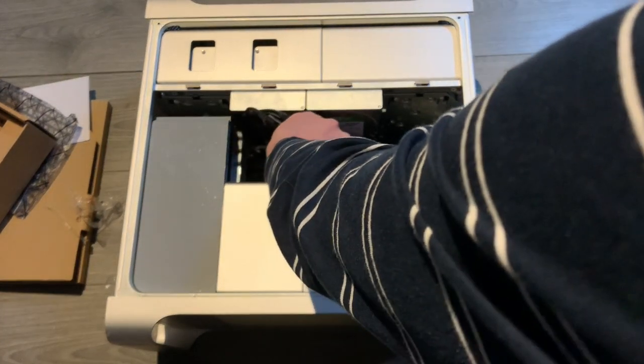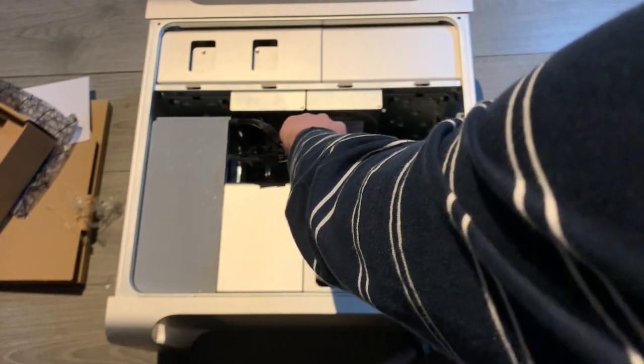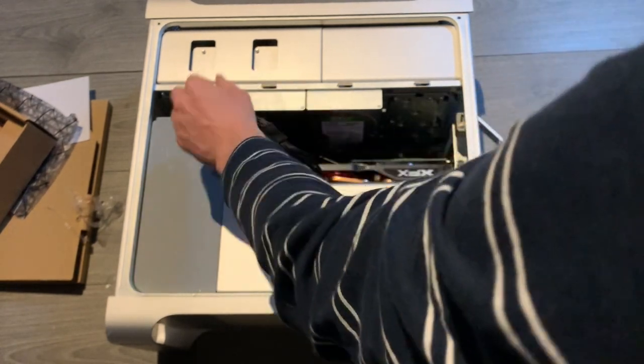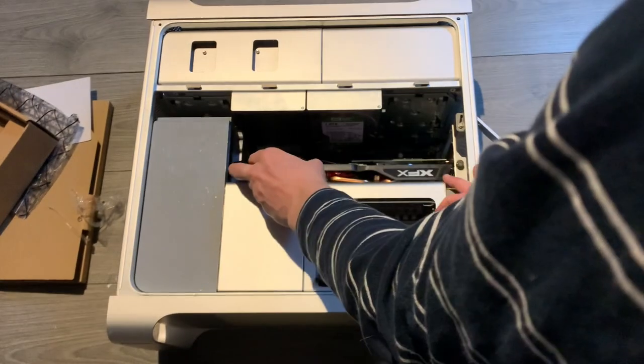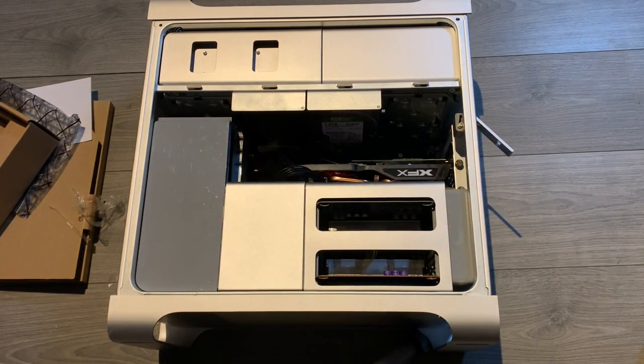Now, I've also read that most of these RX 570 and some RX 580 cards even will work fine sometimes on a single 6-pin, on the newer Mac Pro 4.1, for instance. But I don't want to leave it to chance to figure that one out. I prefer to do it somewhat properly, and this should be the route to take. It's not a particularly power-hungry card, the 570, but I think we'll be fine this way.